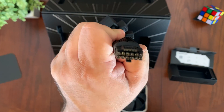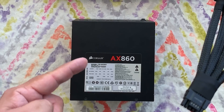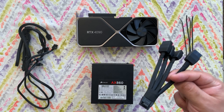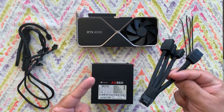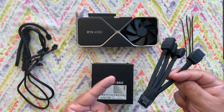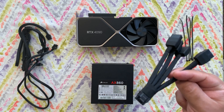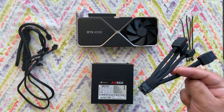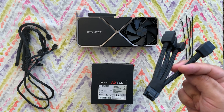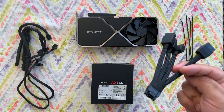You are kind of forced to use this dongle included with the RTX 4090. Otherwise, you have to buy a new power supply with the appropriate connector to power the RTX 4090, or you can wait to see if third-party vendors will sell a special cable to connect your power supply to this specialized connector. Since I want to use my existing power supply and I already have this dongle included free, I'm going to go ahead and use this and see how it looks on my gaming PC.